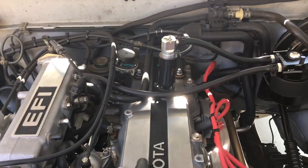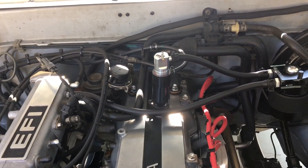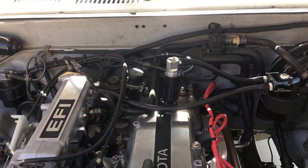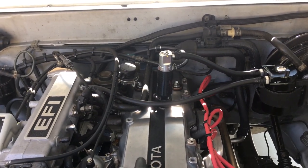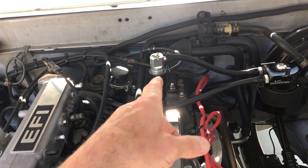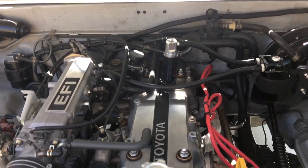What has been working well is running the PCV adjustable circuit such that at idle, when the engine vacuum is fairly high, this PCV valve limits the amount of crankcase vacuum to about half an inch. In other words, when you're cruising down the highway, idling at a signal pulling 17 or 18 inches of vacuum, or decelerating downhill with the throttle plate closed pulling 22 to 24 inches of vacuum — the smaller orifice of this dual channel PCV valve restricts it so the motor only gets about half an inch of suction to alleviate crankcase pressure.